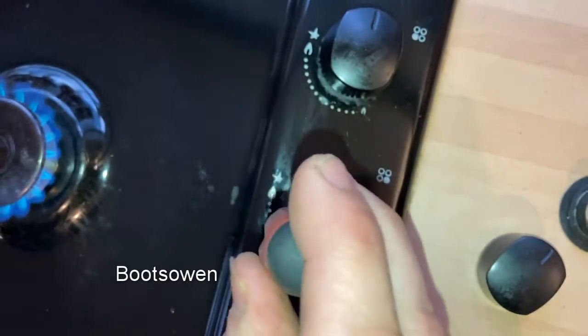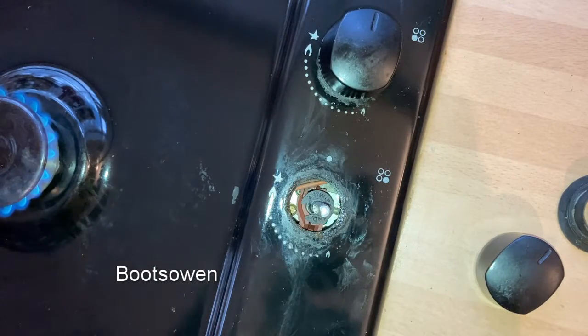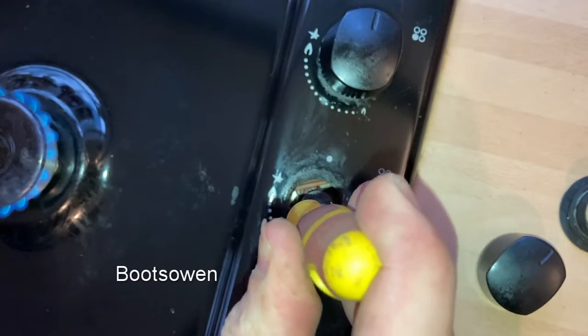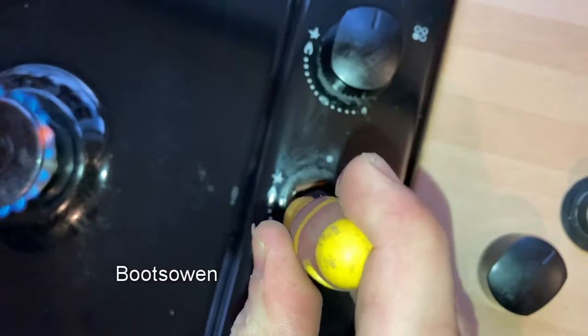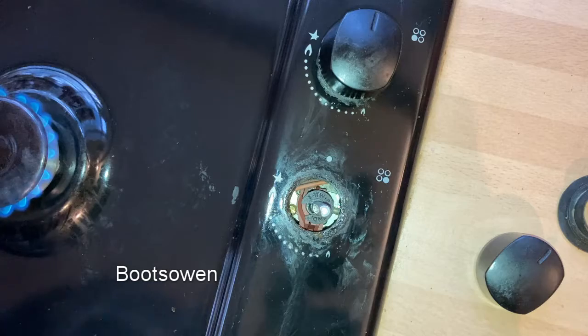Let's turn this clockwise and see what happens. If I was smart, I'd turn it down first, then go at it — because we're not adjusting the high flame, are we? Flat-bladed screwdriver again. That's gone a lot lower. So if I turn it counterclockwise, it goes up. Just turn it down to the last, and that's the end of that. You see that little brass screw in there, just at my fingertip? That's the one.